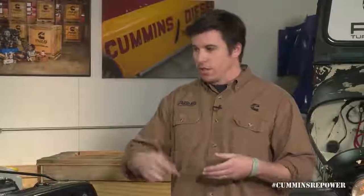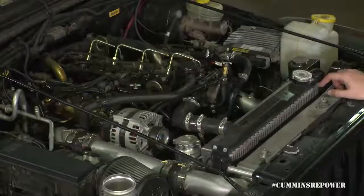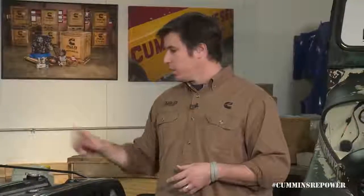But it didn't happen overnight. This Jeep was originally equipped with an inline six, a naturally aspirated gasoline engine, and our engine is turbocharged, so some things need to change. The first noticeable change is we had to move the radiator back — which we could do because we lost two cylinders — but we added a charge air cooler. Once you have that hot exhaust gas spinning your turbine wheel and compressing your intake air, the intake air is hot, and you've got to cool it down before it goes into the intake on the engine. You'll get a malfunction if you go above 197 degrees Fahrenheit on that intake, so it's important to spec a charge air cooler that can get in the 1,200 BTU heat rejection range to keep those intake temps cool.